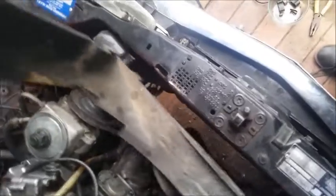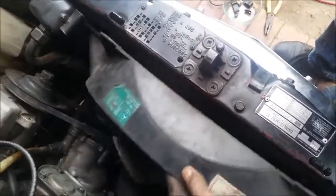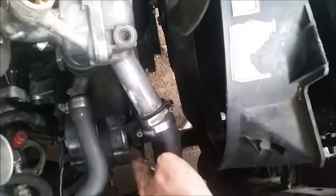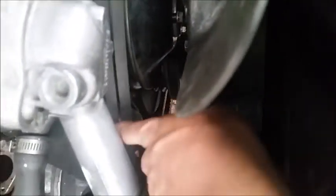Now that the fan is in, the shroud can go in in this orientation, but then you slip it back so you can put the radiator in. Before the radiator goes in, for a little more access room, tighten this one up and then that one, once you've got this into a position where these are taut.